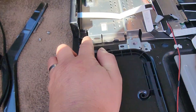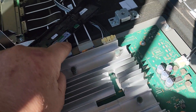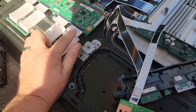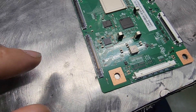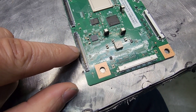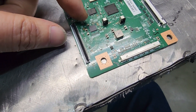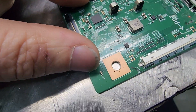I went ahead and removed a screw here and a screw over there so we can take off the power button — this is what's going to give you the flash. Now we have to remove this metal plate. Here's the T-Con board — this is what I was talking about. Each ribbon covers a quarter of the screen. So you pull these out. Before we move on, make sure you do not pull your cable without unlatching it first. Grab your nail and go underneath, then pull up this little tab or winglet. See how that works? When it goes down it'll snap and stay nice and shut.